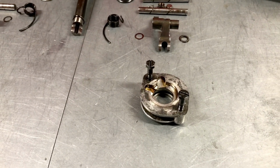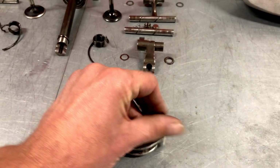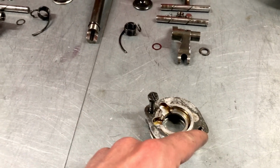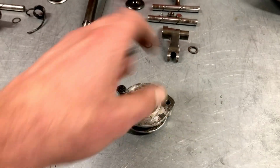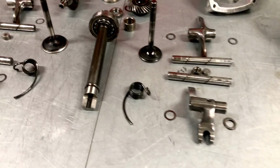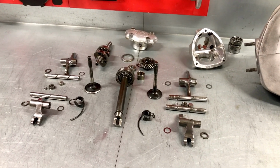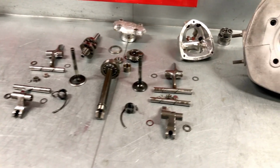That is something which I've never seen before, because these things never wear, but for some reason a larger thread has been inserted here, which is the reason why someone fitted these hexagon bolts in a larger thread. So these are now no longer M6, but this is easily replaced. We have hundreds of those lying around, so no use in trying to improve these. So this goes out, and fitted back with original M6 screws. Which is a minor thing, of course. Upper bevel gear, both sides are in good order, and as well as other minor parts and things.